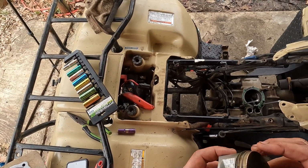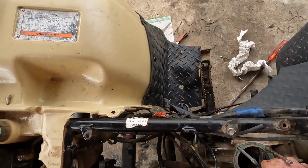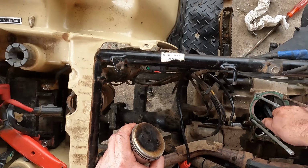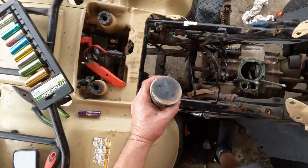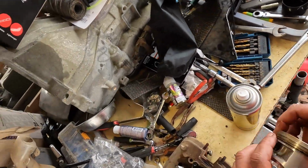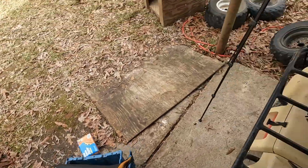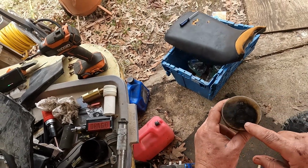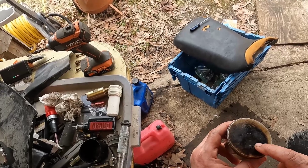It's the factory piston. It's pretty clean. This engine was tight, no slack. Very little slack side to side, but none up and down. None, absolutely none, which is great. I'm gonna keep this still in good shape. Something else real quick. The IN stands for intake, so this is always going to go to your intake side.